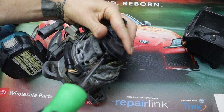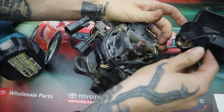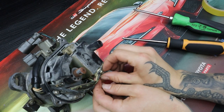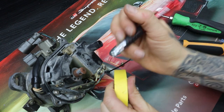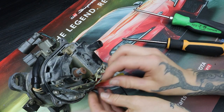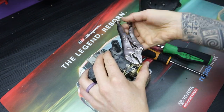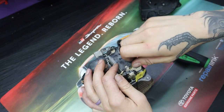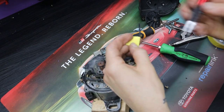Next I'm going to remove the rotor with a number two Phillips screwdriver and pop the rotor off. Then I'm going to remove the coil, starting by disconnecting this wire using a number two screwdriver. I'm gonna label this wire — not too concerned about mixing them up, but there'll be quite a bit of time between when I take this apart and when I put it back together, so better safe than sorry while I wait for all my rebuild parts. The head of the screw was stripped so I had to remove it with vice grips — I'll definitely be replacing that screw later, labeling this one as our negative lead.